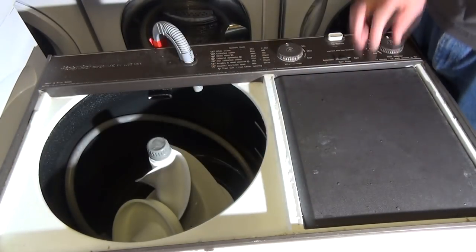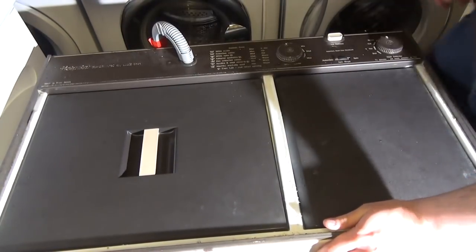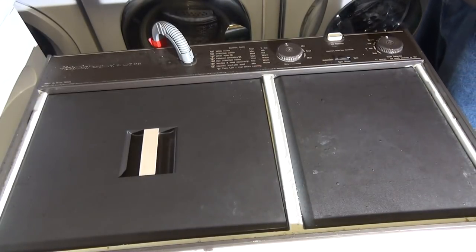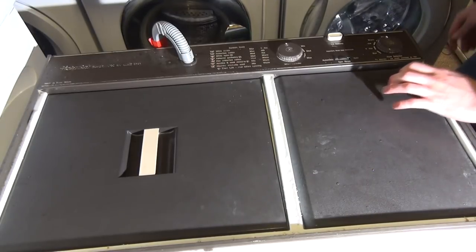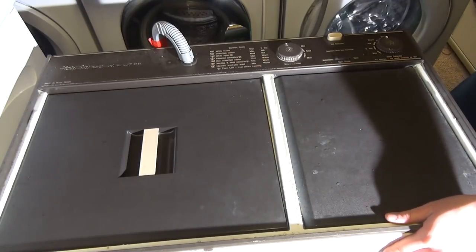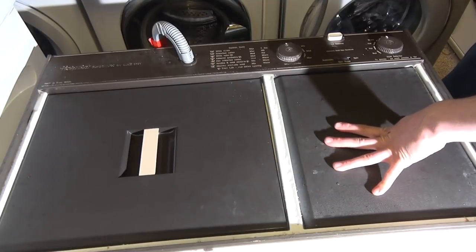And here's my thing about it. I'm sure it's very quick at washing, but of course the heater's blown. And then there's the fact that you get water everywhere. This is just splashing about, and it actually does go everywhere. The recirculation pump tube's starting to go, so that'll come off a few times, getting water everywhere. Then there's the amount of water it uses. That is technically a top loader. And I filled this 14 litre watering can 3 times just to empty it. Imagine doing that over and over again if you're doing separate loads.